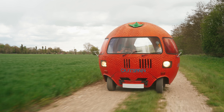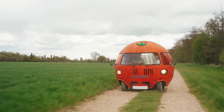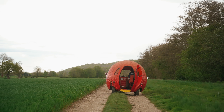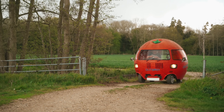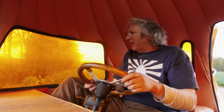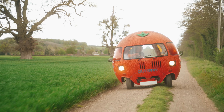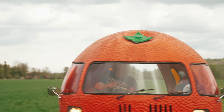Out on the test drive — that is a dreadful noise. I'm quite glad actually to be driving with the back door open, getting some air going on. That noise is getting worse — I have a funny feeling something might explode any second. But the good news is there's definitely no fuel starvation anymore, which is great, so at least I've fixed that problem. She's running quite nicely, but it's rather hard to ignore that horrible noise. Basically, it's a bearing giving up. I think it's either coming from the alternator — which is not so hard to fix — or it might be coming from the water pump, which is obviously a slightly bigger job on one of these, particularly with that lack of space. I'll have to have a look at those later.